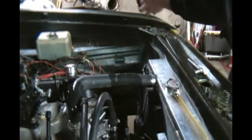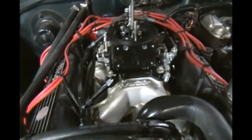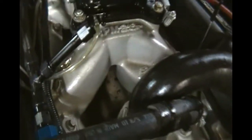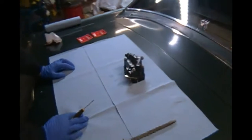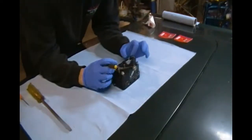Just dump that everywhere. So you don't actually need to remove the carb - you're just removing the front bowl. It gets flooded full of fuel back there. It burns. We're coming over to the workstation here. You got the front bowl off. You can completely remove the front bowl here. Here are your four bolts. Don't lose your Teflon screws.